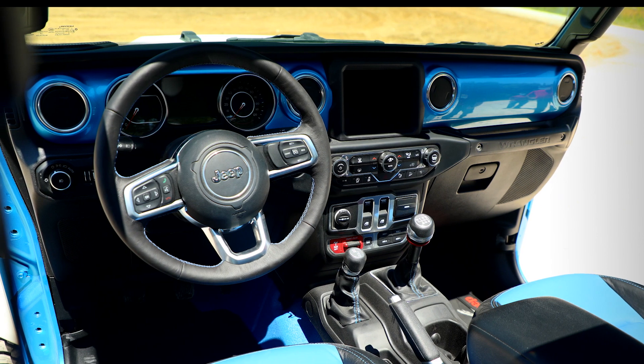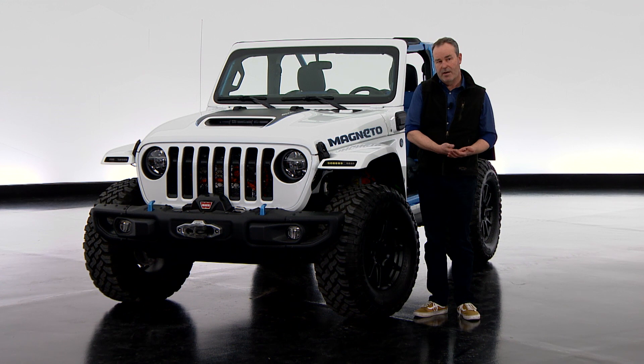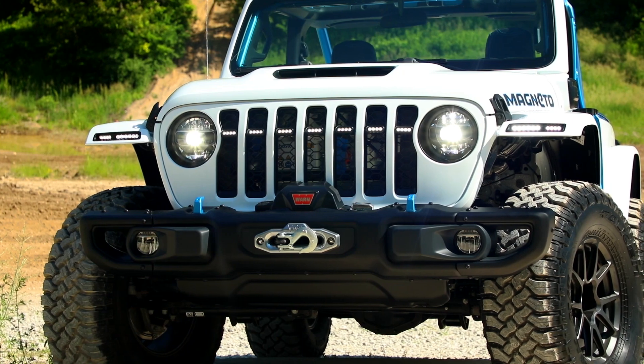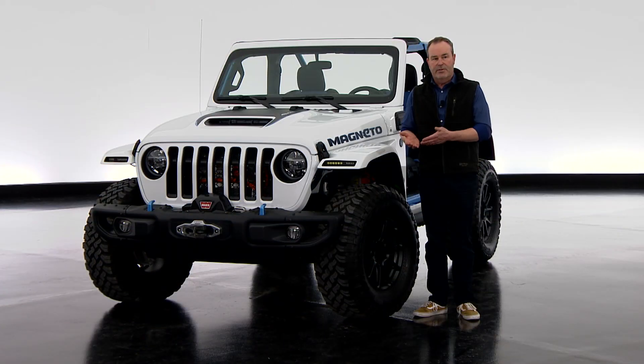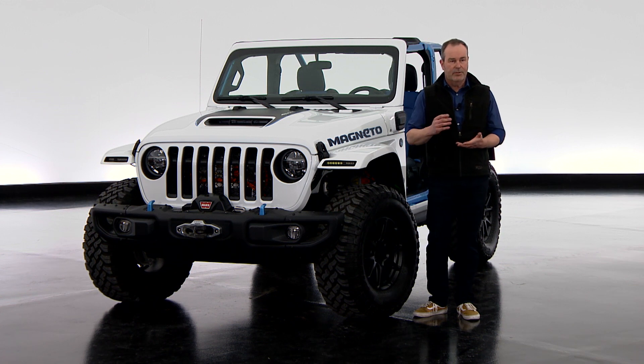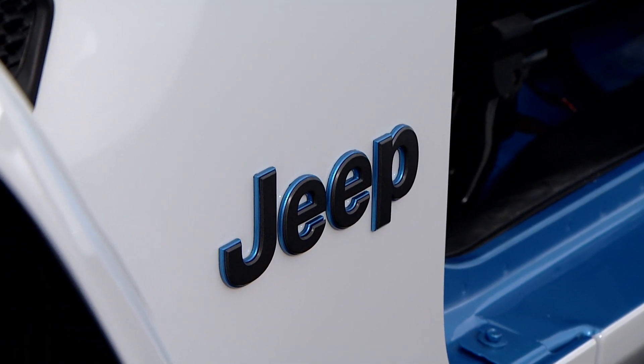The reason we did that was to get the best of both worlds of the automatic and manual transmission off-road. I can do lots of gear selection with the manual transmission, including low range. I don't have to worry about the clutch, so I get the direct feel of a manual transmission off-road but the ease of drivability of an automatic — you don't have to slip the clutch to get over rocks because the engine can't stall.